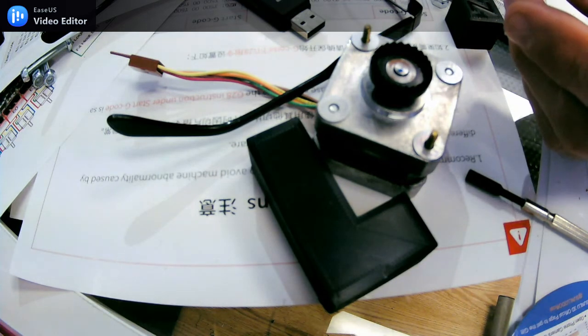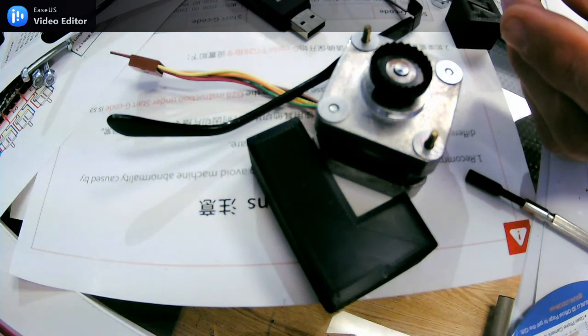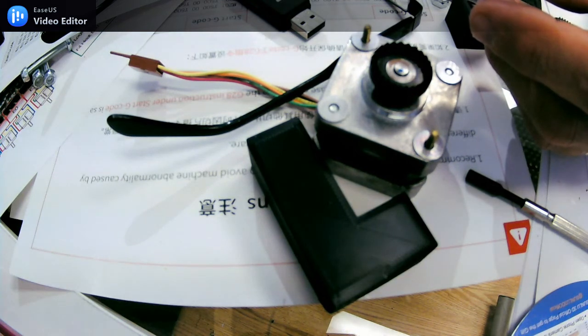So I tried the one that they said is most likely to work, an FT232R driver. Nothing. Then I linked to a CH340 driver, and it worked right away. So I was able, with a Windows computer, to talk to the printer and update extruder settings.